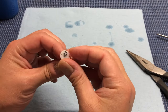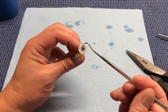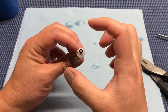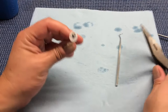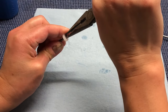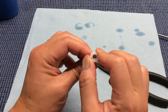Putting the E-clip back on is really straightforward. You basically just put it on top like that, then one edge of the needle nose is going to go up top against the E-clip and the other one on the bottom against the shock shaft. You basically squeeze the top and bottom straight together — like 12 o'clock and 6 o'clock — pinching them together, and it should just go straight on. It's straight on there and nice and tight.